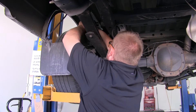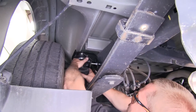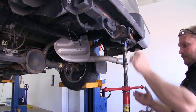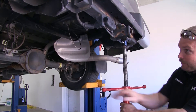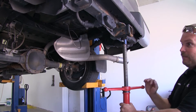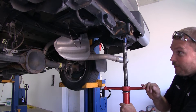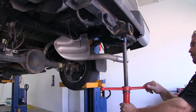Now we're ready to put our air spring with the lower bracket up into place, aligning the elbow where the air fitting hose will connect through the hole in the upper bracket. Since we're on a lift, we used a pole jack to help raise the rear of the vehicle and spread the suspension apart to make this a little easier. If you're working off the ground or on jack stands, a floor jack at the rear tow hitch area will also help lift up a bit and take weight off the suspension.